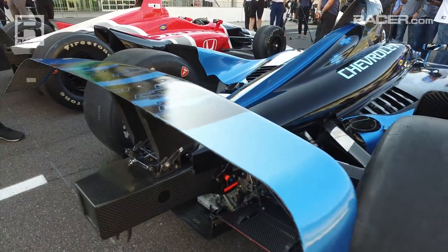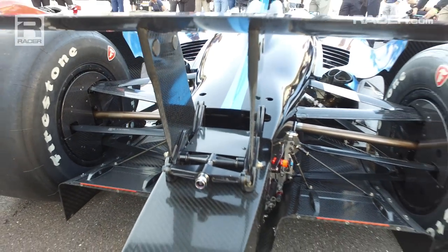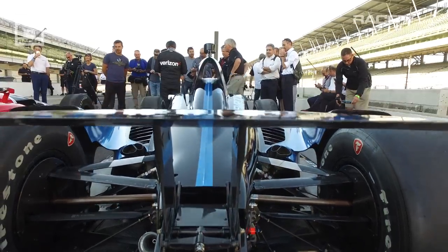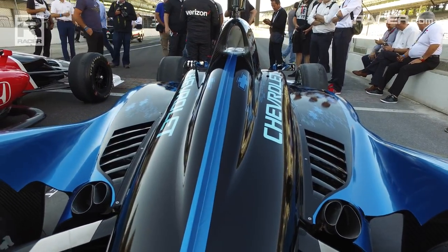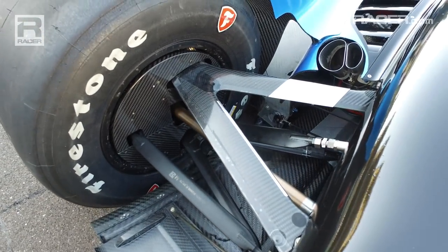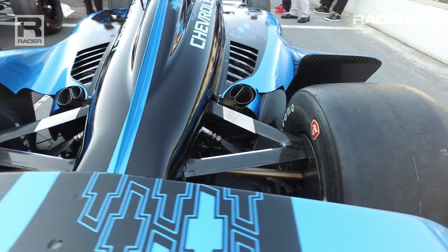We have this downward angle on the rear wing — there's a consideration of angling those upwards. There's a part of me that thinks this either needs to be higher or swept back so it stands apart from the car a little more; it just gets lost from some angles. There's a rear wing adjuster — wing angle adjustment sounds like that's going to be the main tuning item compared to bolt-on wickers and whatnot at the front and rear. At least at Indianapolis; Pocono could definitely be a little different with more wicker options. Beautiful low engine cover — something that I think is IndyCar. Now that we're going back to it, it needs to stay. The backside of the ramps, the opening there wrapping from the inside of the side pod going between the ramp — you can see a little NACA duct hidden in there for some cooling of electronics.